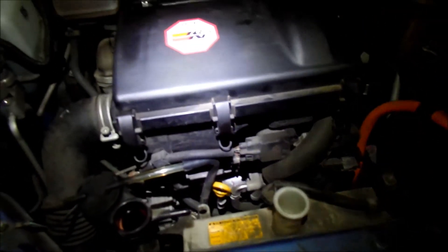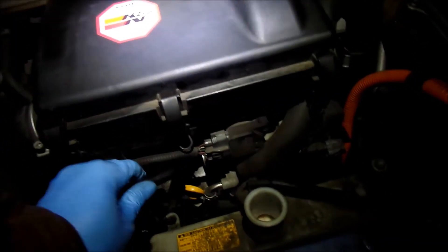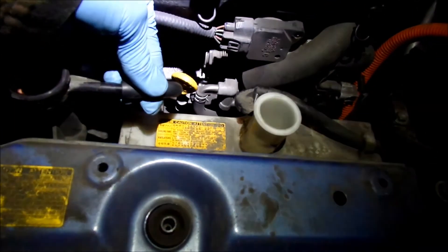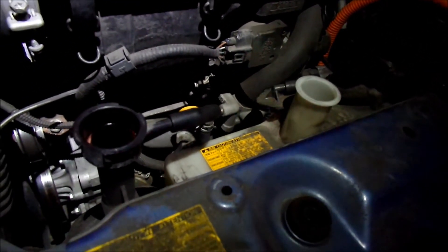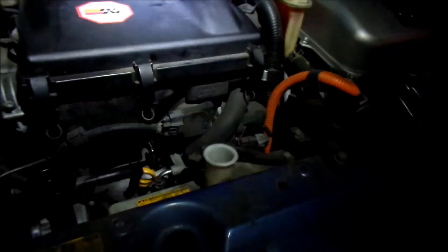I drained about five or six cups into the jug — that brought the total up from halfway to about three-quarters of a jug, so we're just under two gallons total. If you're not using most of that coolant going back in, something is wrong — that's how you know. Now go ahead and unplug this, put it back into where it goes, and be very careful — this radiator neck is very flimsy, it's not the best design, Toyota. Make sure you support it with your hand. Now it's time to start filling it up with coolant.